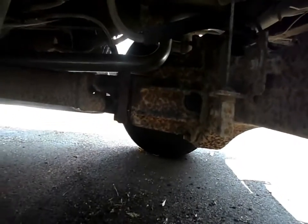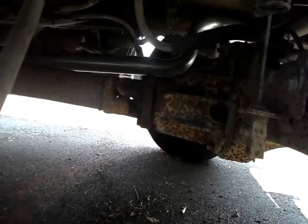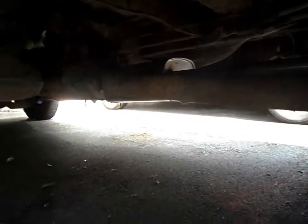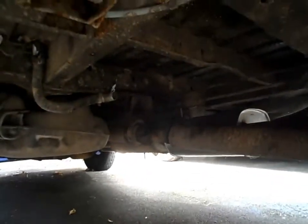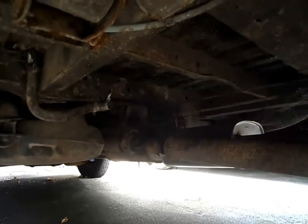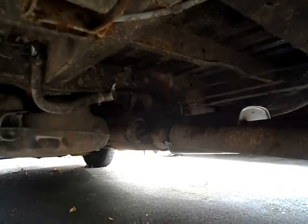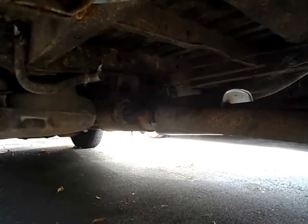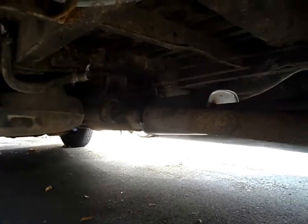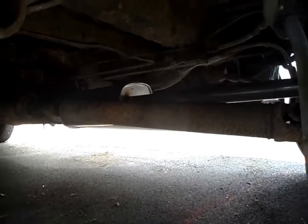Here's the diff in the back and that's very easily accessible - just take the rear wheel off, jack it up, put it on a stand. Looking a bit further back you should just about be able to see the first centre bearing of two. Both of those need to be undone, and also at the gearbox end I've got to remove the four bolts holding the other end of the prop shaft on, then the whole thing should drop down.